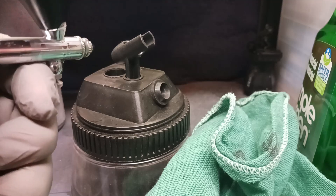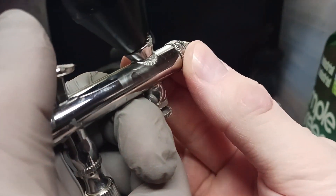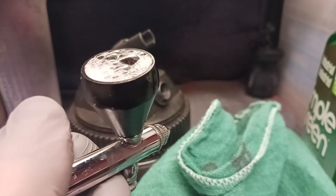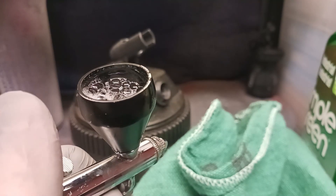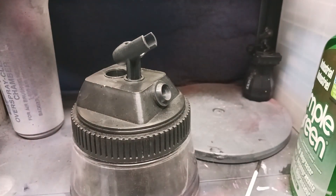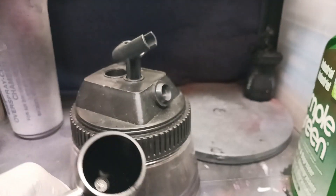Spray a little bit into the back of the booth, then spray a little more. This time we're not going to overfill it. Adjust your nozzle — since we've got it on self-cleaning mode, it's going to be bubbling pretty heavily. Make sure we don't overflow it. Stop, let it die down, do it again. We're doing this because we're trying to get all of the primer or paint that's built up inside the bottom of the color cup and clean it out. Just wipe it out with the cloth you use to block the tip, then take a Q-tip and wipe up the area around the needle.